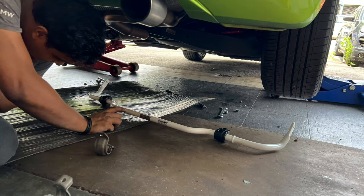I did want to do the strut bar as well, but for some reason they sent me the wrong strut bar — it just wouldn't fit because of the throttle body. It was touching the throttle body and leaving a gap from the screw of around two inches, so there was no way to modify it to fit. I believe there's another version of the bar, but I'm skeptical, so that will maybe be a future video. For now, I just upgraded the rear anti-roll bar to a thicker one, which honestly makes a lot of difference.